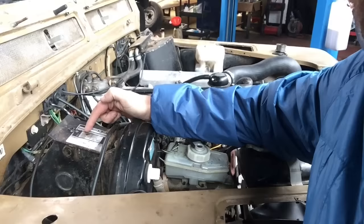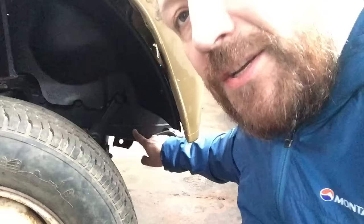Another key area is the chassis numbers. On a Defender you've got two areas, and on later Defenders a third. You'll see here we've got a VIN plate — that's really important. Make sure it hasn't been tampered with. You've got a chassis number printed on there and it needs to match the chassis number stamped on the chassis. Underneath the vehicle on the driver's side, it's actually stamped in, so make sure that's there. Always be wary if it's been covered up. Don't be afraid to ask the seller to drop the steering guard so you can check the chassis number. It's really important, and make sure it matches the one on the servo plate of the brake just here.